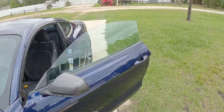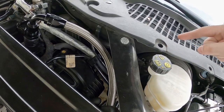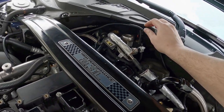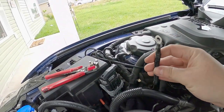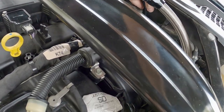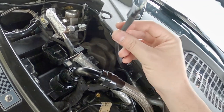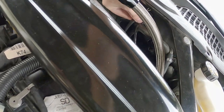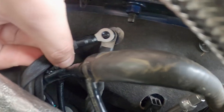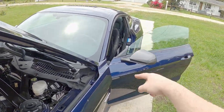Day two on the wiring. Last night I got a little bit of work done after I ended that last clip. I ran the power harness coming through the firewall and it's going through this loom here — this is only the positive wire, which I already terminated to a ring terminal that will go right where the battery cable goes. Back here on the harness, I added the ground cable, which is going to go right on that ground stud right back there. That looks nice and factory — I like that. Today I've been busy in here, so let's move on to the inside.